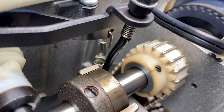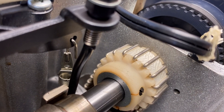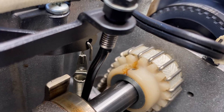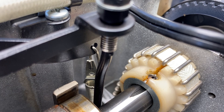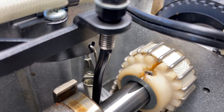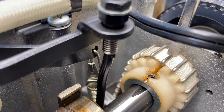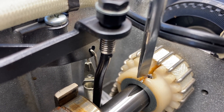The problem with this machine is that the gear they made is plastic, and you'll see there's a large crack in it coming up. That crack is very serious — it's the end of this thing, because when there's stress on it from the cleat of the belt, it splits the crack apart.